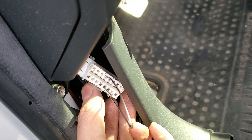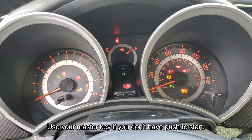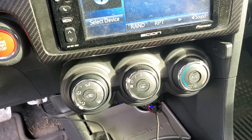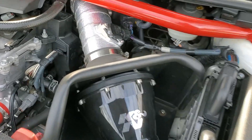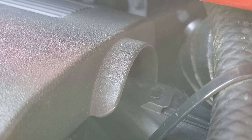I have the pins shorted together and the car turned on to accessory. During this process, your dash lights are going to flash like this. I recommend turning off your radio if possible, make sure the blower is off, and unplug any accessories to reduce battery drain, since we're going to leave it on like this for 30 minutes. I noticed a whining noise when I got out of the car, but this appears to be part of the process. Now to set a timer and wait.